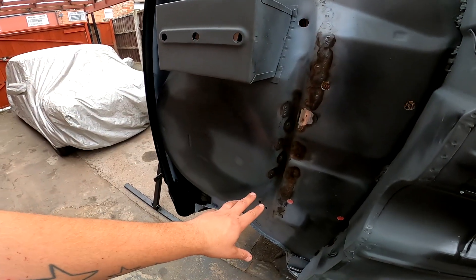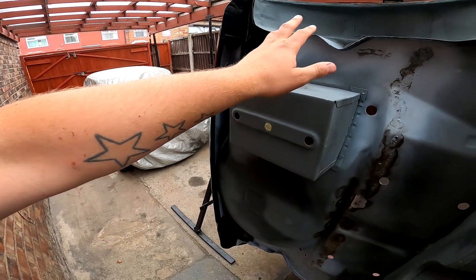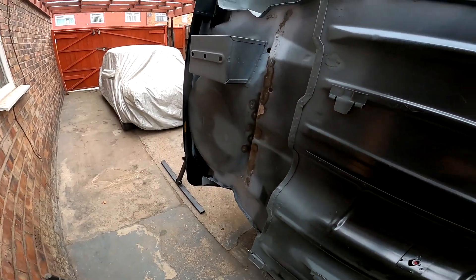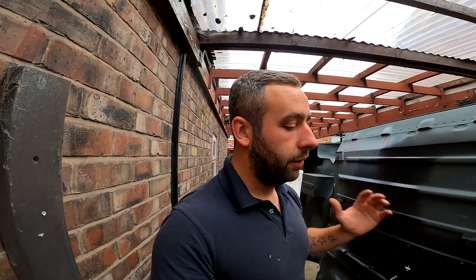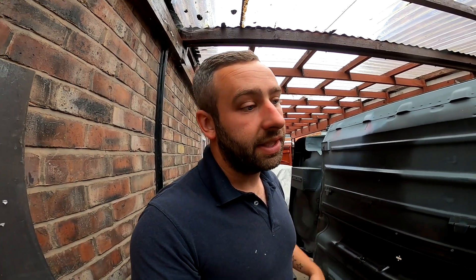This is just heat penetration from where I've welded. We've done an arch repair that just needs dressing back. I've done a little bit of seam welding on the sill because it's plug welded and then seam welded as well. You don't have to do that, but I like belts and braces. The subframe's in there, the seams are sealed. You're not going to know, but I know I've put a bit more strength into the car - it's been apart so much.